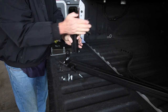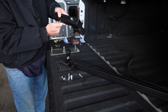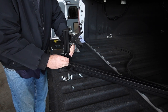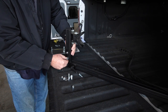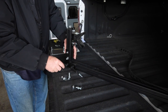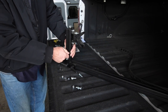This V piece is going to go in line with the strap. You have a bolt here that slides in, and a second bolt goes in the top. Undo the nut and slide that into the hole — it'll go on the bottom nut as well. It just takes a second to get it lined up. The top of the bolt slides on the inside of this channel and locks into place on the L bracket. We use a nylock self-locking nut to keep it tight — tighten that down.